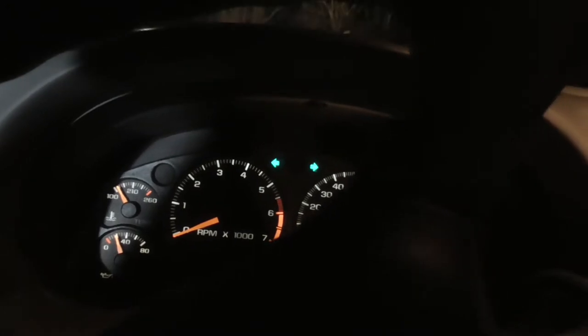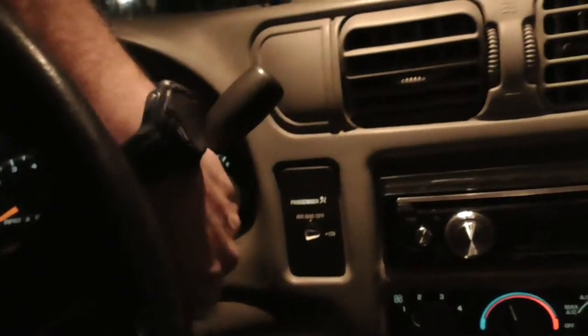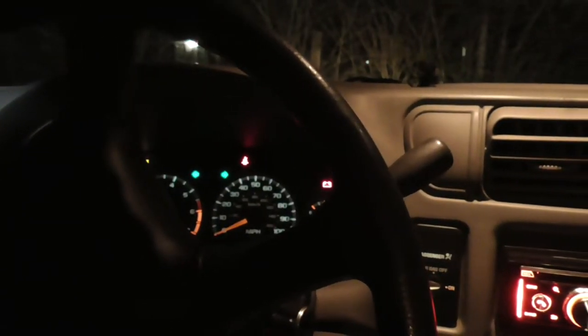That's weird. Put on the brake and the flasher stopped. Never mind, it was already doing that. When I first got the toolbox, which I don't think I've shown y'all, I didn't have it closed all the way, and it flew up going down the road. When I stopped, I had to turn my flashers on, but the flashers stopped flashing when I pressed the brakes, which apparently is a GM issue. Apparently those GMT 400s do it, but mine doesn't. My GMT 400 doesn't do it, but I know a couple of my buddies do. That's really weird. It doesn't do it with the turn signals, only with the brakes. But apparently it is an early GM problem that I never had.